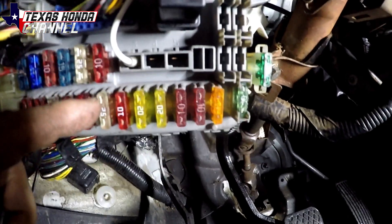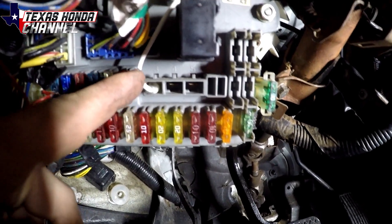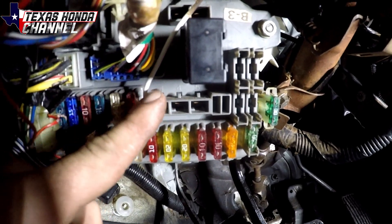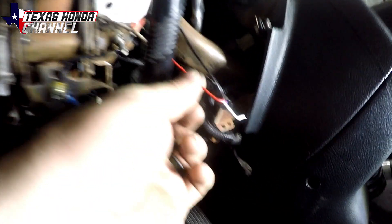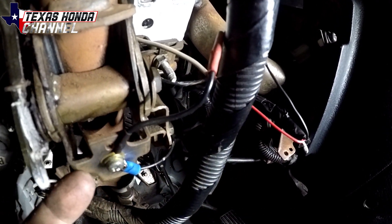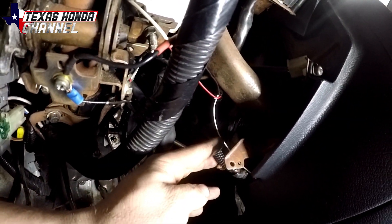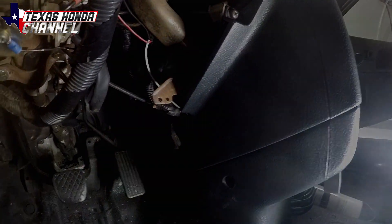So for the wiring, the positive I have ran right here. This port says three right above it on the EF. On other Civics it might be the same or different, but this is a positive that comes on when the key is turned forward. I have that positive ran into the red wire. The ground I have heat-shrinked — cleaned to bare metal, also shared with my stereo, so these are both really good grounds. And as for the white wire, I have soldered an extra length of wire for the computer data log input.